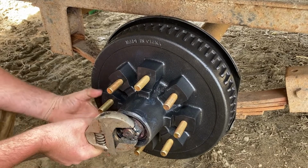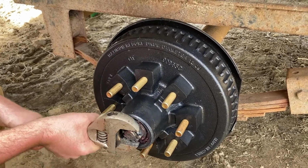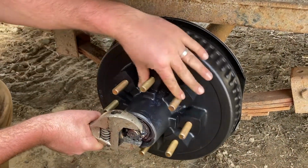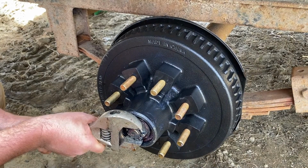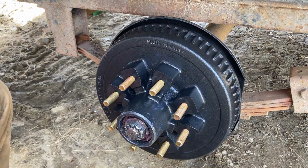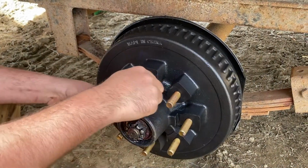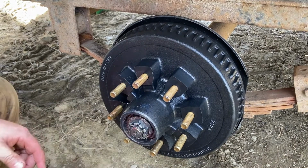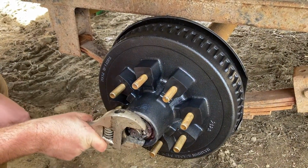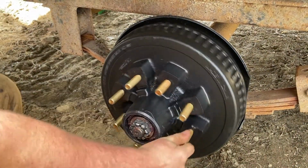Hard parts of the brakes that are dragging in there. My bad. There we go. That's not the brakes dragging, it's actually the bearing. Backing off 1/8 of a turn. Let's see how she comes now. Slight drag still. Back off to 1/4 turn. My problem was I didn't have it initially tight enough. Oh, that feels pretty beautiful.